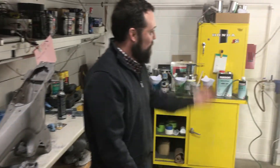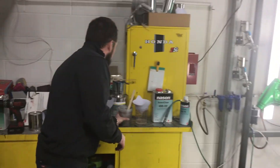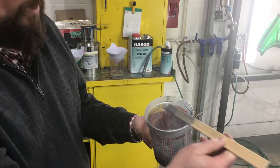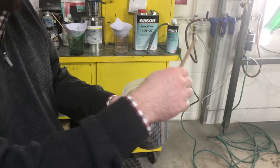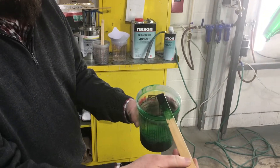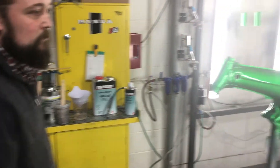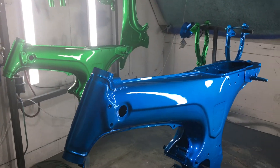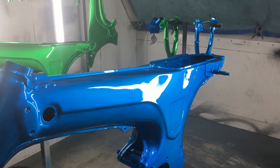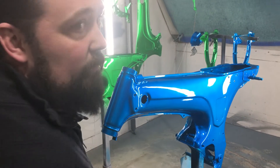After that, we do some finish bikes — this is the candy process. You start out with a silver base on top of the primer, which gives it the metallic flake. Then in this case, we do green over top of that, which you can see on the parts here. The last step is clear coat. There are also a lot of wet sanding steps before we do the final silver on top of the primer or any high-build primer. If there are any little dings or dents, we do a light icing filler to fill those in.